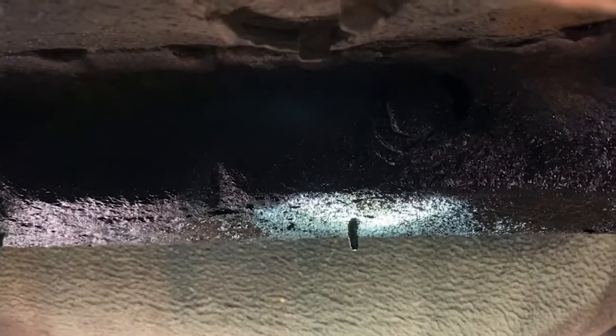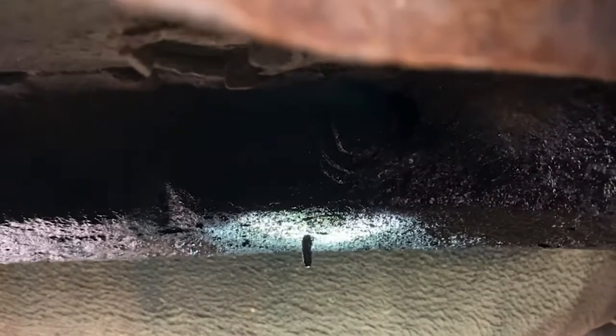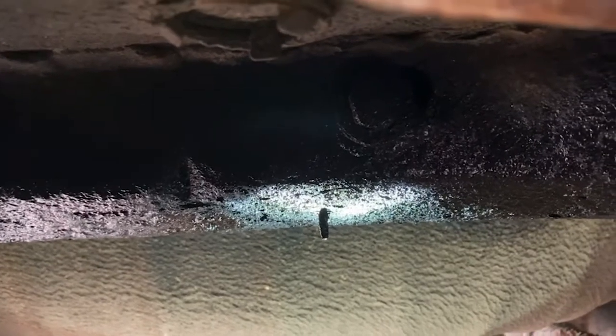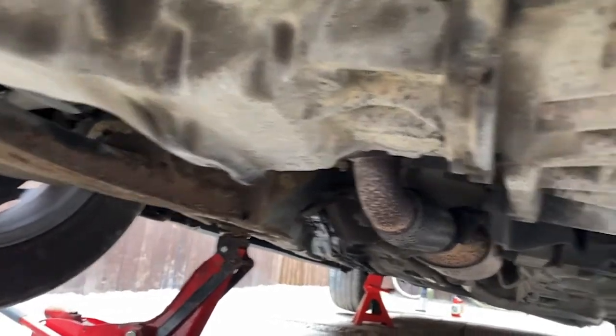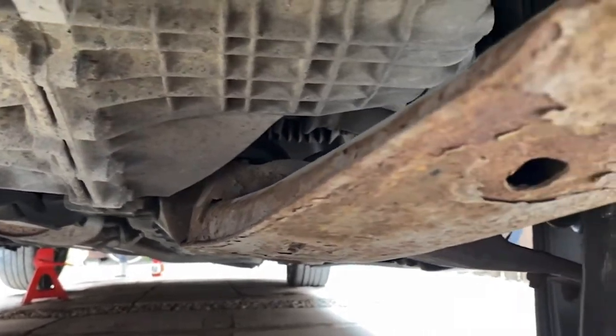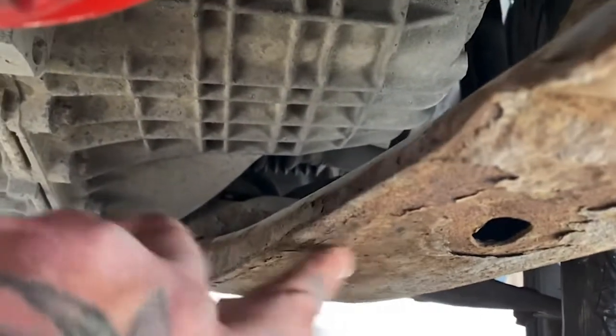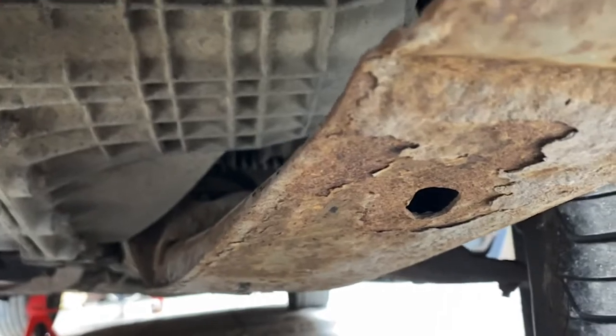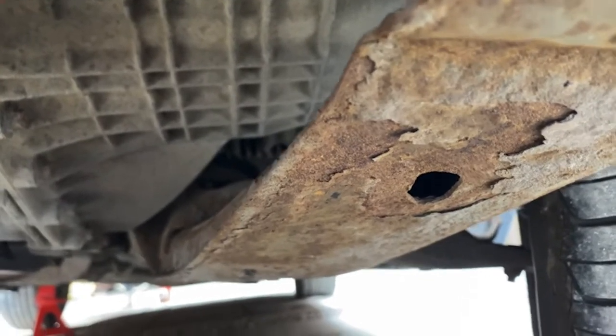So up there on the rear chassis leg, I've just given it a quick spray of black underseal. I gave it a tap and a bang and there was no holes or nothing, but it did look a little bit scabby. I gave it a tap and a scrape and just a quick coat of this underbody seal just to tidy up a bit. I'll keep an eye on it. And under the front, there's no major leaks or anything, because I'm aware that major leaks fail. There's the front subframe. It does look a bit, it's actually the paint peeling off. That could be a job for me later on in the year. Give it a good wire brush and a good lick of black paint. But yeah, the subframe's solid.